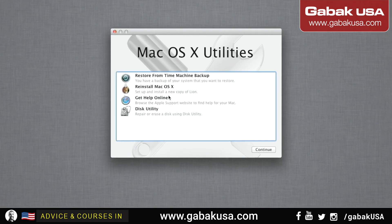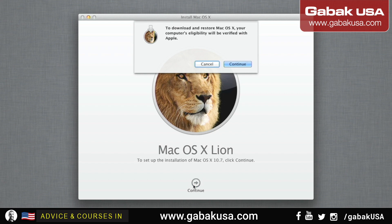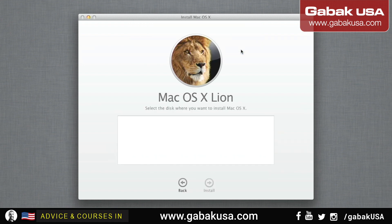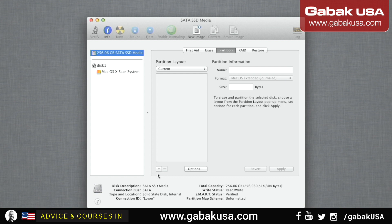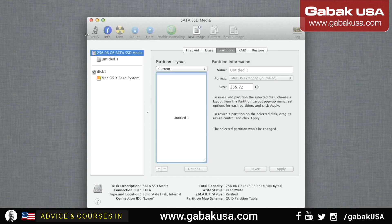Let's go back and see the screen — everything is booting up. Now we are going to reinstall Mac OS. It will ask us to format the hard drive. We have to format the drive, so let's see if we can do something from here. We'll have to quit and go to the Disk Utility. Then we add the drive, partition it, add one partition, and apply. Are you sure? Yes.